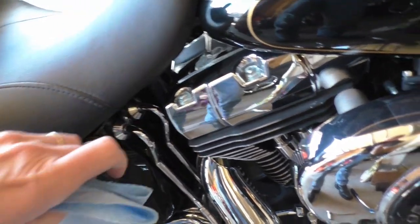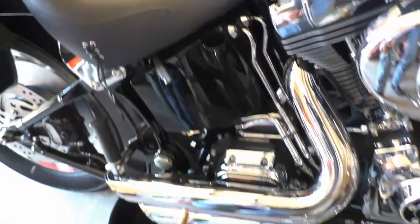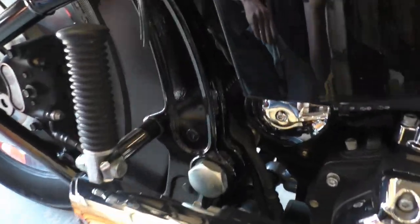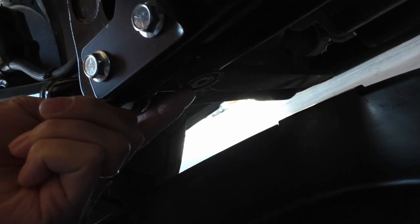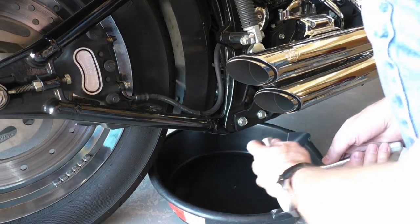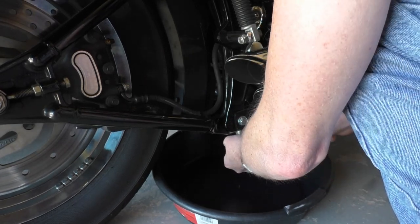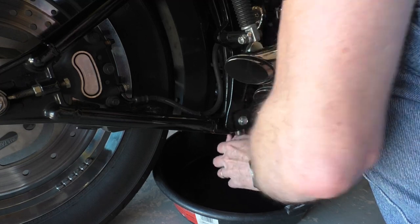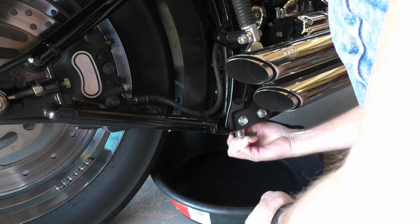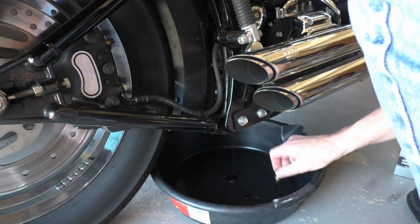I took the bike out and warmed it up. The first thing I'm going to do is pull the oil dipstick off here so that it drains nicely, and I'll clean that off in a minute. The oil drain plug comes down from the tank and is underneath on the frame down there — right up in here. So the first thing I'm going to do is pull the drain plug. Make sure you're lefty-loosey when you get up under there. Give it a tug, and the rest can be done by hand. You've got to be quick so you don't spill too much on yourself.